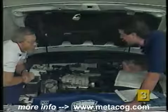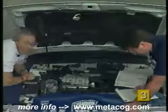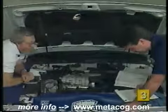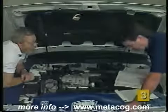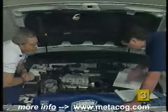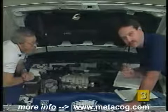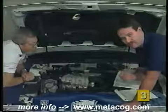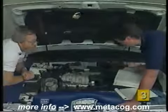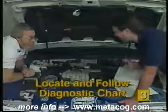So it's actually telling us what we didn't do and we should have done during our test. That's right. We should have turned the steering wheel all the way to the right and then all the way to the left. Okay. After the dynamic response code. Right. Okay. Now, our 74, let's see what that has to say. Our code 74 basically says we've got a brake switch problem. If we did have a code 74 when the engine wasn't running, we'd want to check out that brake switch. But engine running, it says we did not step on the brake pedal during our test.